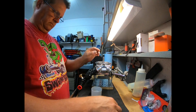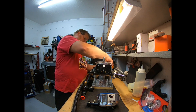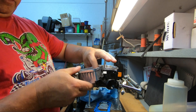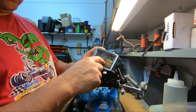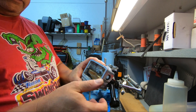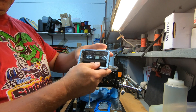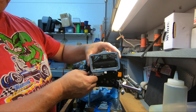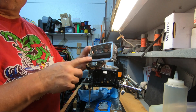Okay, I got all the bowls off. I like to just look inside and see if there's any chalky stuff on the bottom, around the top, any of that. Check back where the float connects, make sure it's still moving up and down pretty good. Just check for any type of chalkiness. I don't see anything in here - I think I'm pretty good on this bowl, and this one as well. I normally go ahead and drain the fuel out of the pumps, just squirt it back into the bowl, give it a squirt, get all the fuel out so it's totally empty.